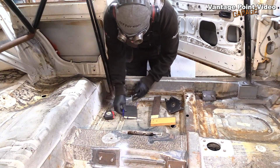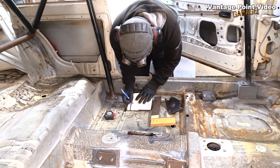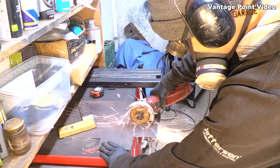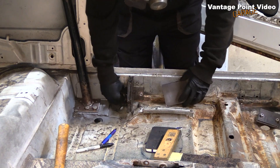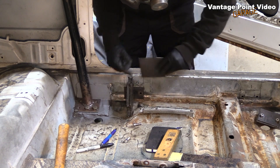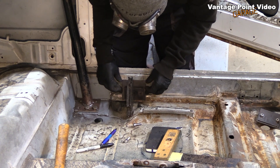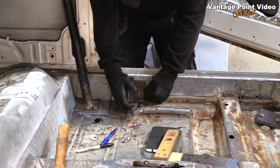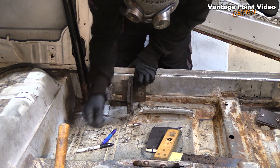Now this one I want to incorporate the original hole for the seat belt, so I'm going to extend this plate up because otherwise the edge was just way too close to it. I may use these bolt holes for the harnesses. The harness cannot be attached to the seat supports, but this is going in the counter plate so it's actually going through to the original attachment. So my interpretation is that this is not on the supports but on the reinforced part of the car, and its original reinforcing is still there - you're allowed to use the original anchor points. So I hope I'm getting that right.